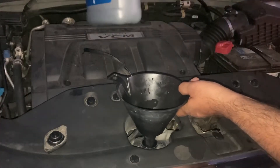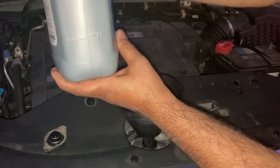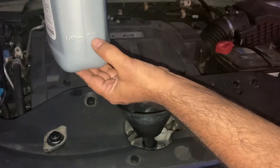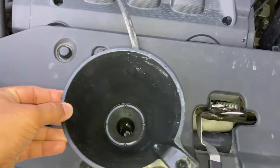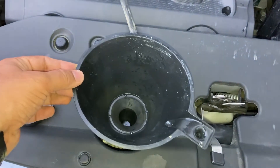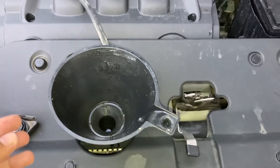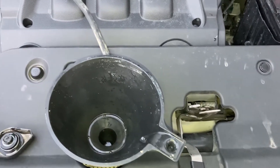Looking at the bottle, I can see the marker. Right now I'm at less than one quart remaining — I've filled the radiator with quite a bit of fluid and have about a quart or a little less left. Now I'm going to start the car, wait for the radiator fan to kick in, and then burp the system.